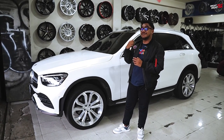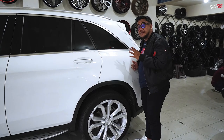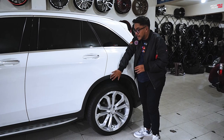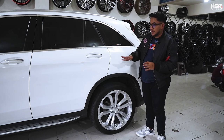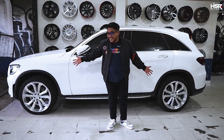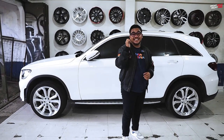The fitment is great. Looking at the rear, with ET 40 and 9-inch width, it sits slightly inward — same as the previous Ring 20 wheel. The rear fender flares out a bit, so the wheel sits nicely flush or rata at the back. If you load up the car with passengers and luggage, the fitment is even better. From a distance you can clearly see the quality. HSR Forge is top quality, and on the GLC 200 it looks fantastic. Let's see the next wheel.